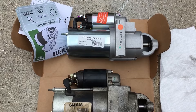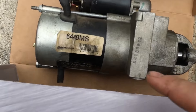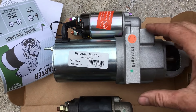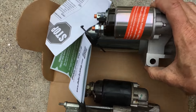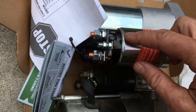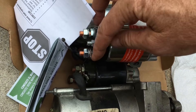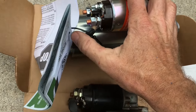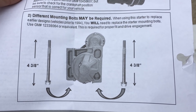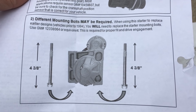Here's a look at the new starter versus the old one. Rather than a rebuilt unit, I bought a new one — the old one is a rebuilt from Mexico and the new one's from Malaysia. You can see the nuts that need to be connected: the little wire goes to the small nut, the big wire to the big nut, and this third terminal you just leave alone — it's connecting to itself. Note: the literature says you might need longer bolts if it's a 94 or earlier model.